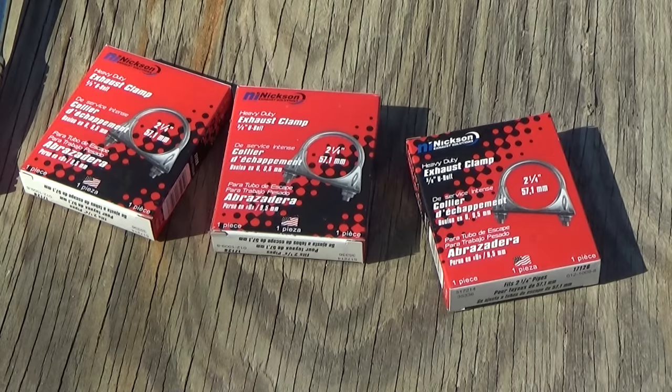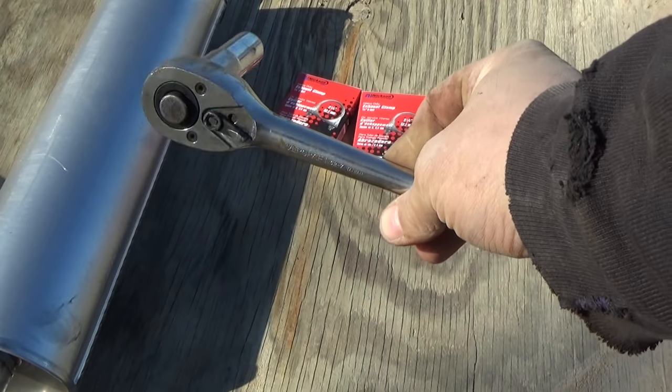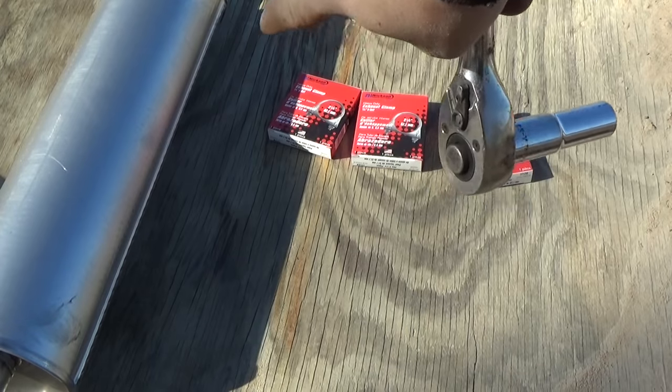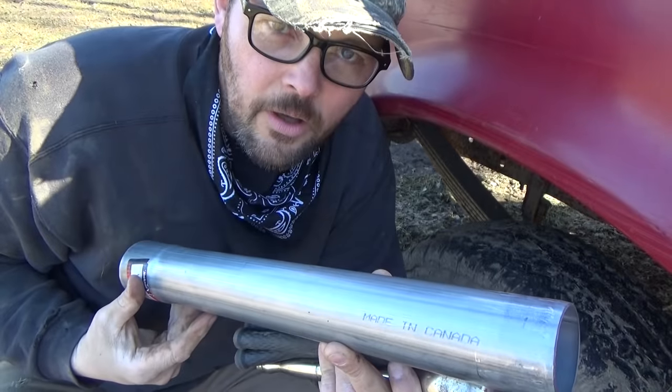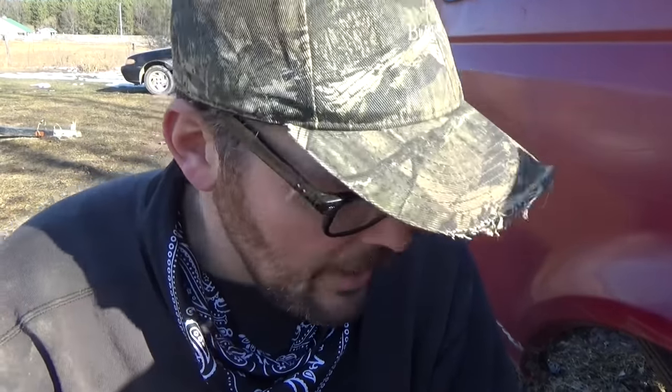Here are the parts we're gonna need: a new tailpipe, enough exhaust clamps to make all the connections, a ratchet with the right size deep-well socket to fit the exhaust clamp nuts, a replacement muffler, and a short section of exhaust pipe. When it comes to exhaust work, the biggest problem is always matching up the pipe — there's two-inch inside diameter, two-inch outside diameter, two-and-a-quarter ID, two-and-a-quarter OD, two-and-a-half ID, two-and-a-half OD, and on and on. When you go in to buy your parts there's gonna be a million different options, so it's best to sit down with a pad and paper and figure out exactly what you need before you go in. It can be a frustrating experience finding all the right stuff.